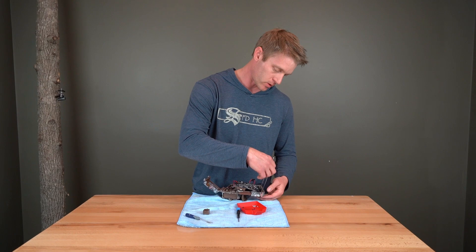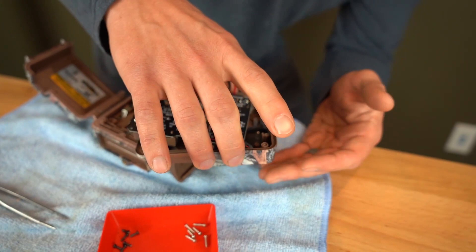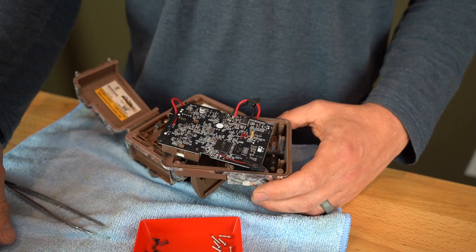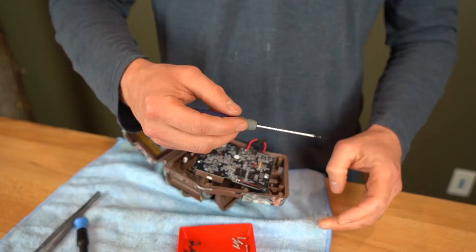Kind of work from both the front and the back with the tweezers and then your hand on the bottom here. Just be really careful — there's no rush in any of this. Let's just make sure we get it in without damaging the circuit board. I can check it from the bottom without stretching the wires, and it does look good. So now I can take this little plastic piece again and drop it back in gently, and we're going to reverse the process.